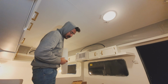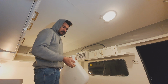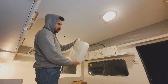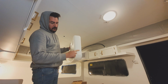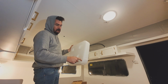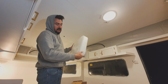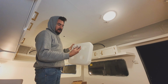The first kit I had actually had a low pickup point in the tank so that you could run it pretty low. I think in all the new kits they just put one fuel barb in here, so it goes in. Depending where you want the nozzle, because you can run it either or. It goes in down here, so they've changed the point. In the old tank I had, that mounting point was about a third, and then you had an internal line that ran down and around. But it was so hard to get in, I didn't do it, so that the tank only has about 10 litres capacity, really, because you can never draw down the bottom. Which is good, because that's where the sediment goes anyway. They've taken that point down a little bit lower here, because you're never going to get that much sediment. And yeah, they don't run the internal looping now, just the barb itself, which is probably a bit easier to fit.